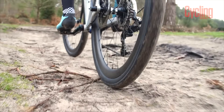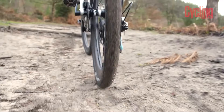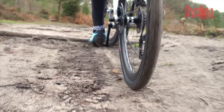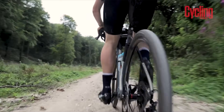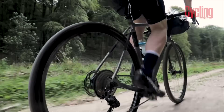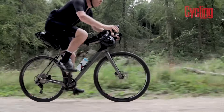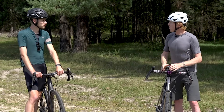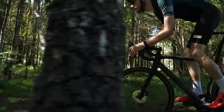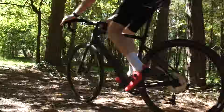We're not talking about letting loads of air out — we're talking about maybe changing it by one or two PSI at a time and seeing how it feels. You're looking for that balance. The other thing to consider is that tyres are different widths and different volumes. As a rule of thumb, the bigger the tyre you've got, the lower the pressure you can run, but it's just one thing to consider. If you've got a narrow tyre, you can't really run it at too low a pressure.